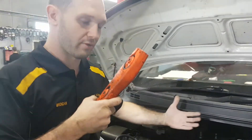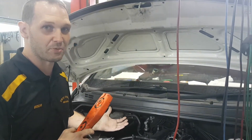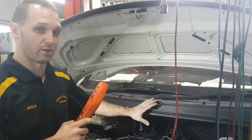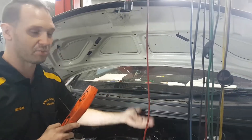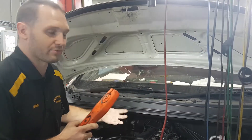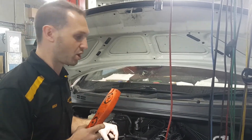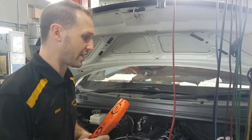I was just looking the engine over and there's lots of oil coming out of the intake pipes, particularly for an engine that's just been rebuilt — it's just covered underneath the car. There's a lot of blow-by gas coming out of the oil cap there, so my main concern is that we've got a compression leak into the crankcase and we've got massive blow-by that's going to eventually cause carbon in the pickup and could destroy the engine again.